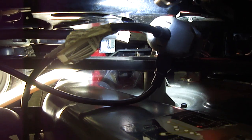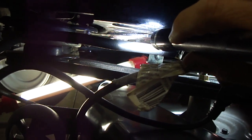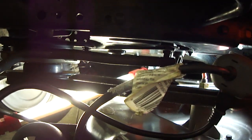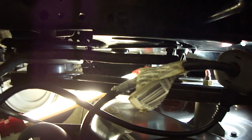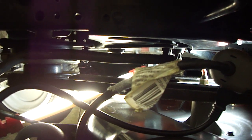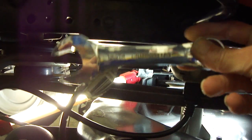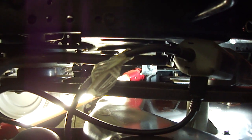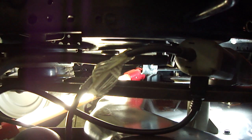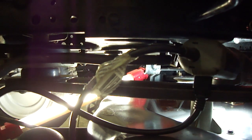It's pretty simple. Right there in the center, that's your primary bolt that holds the steering gear. That is a 19 millimeter and there's a nut on the top side — it's rather difficult to get to, so I use a very short 15/16ths. It gets into that tight area because the drive belt is right in the way and a lot of other components, so you need something compact. I basically broke it free by hand, no problem.